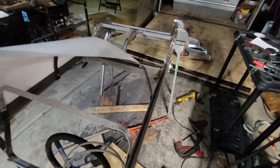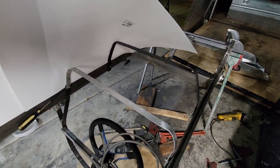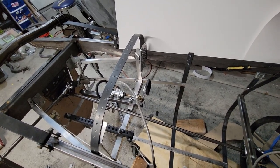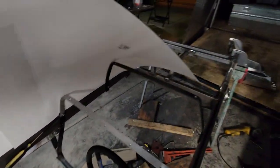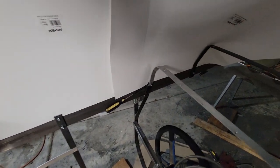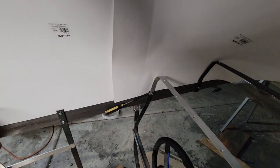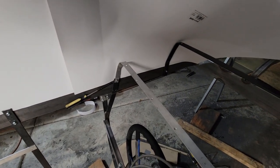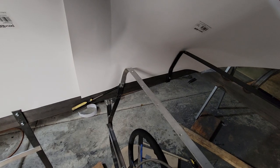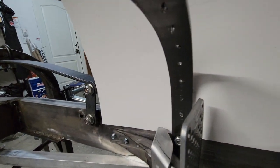I made this bracket for the drop seat — these two brackets for the drop seat — and then this one up here underneath my pedals. I've got cardboard templates in here, so the idea is the edge will just nip down in there and tuck in between the frame rails and those brackets right there. I've pre-drilled these brackets for rivets.